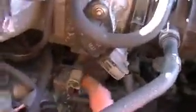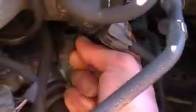On this vehicle right here, which is a 3.0 V6 1998 Accord, I'll show you what that body style looks like, which is this. Good old 98 model. Here's your air duct right here. You follow it to your throttle body, right up underneath it, right here. This is your idle air control valve sensor right here. So I'm gonna just go ahead and unplug it right now. And basically, there's only two screws holding it in. But what I want to do is clean it out real good.